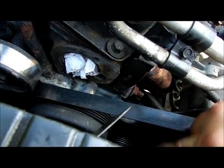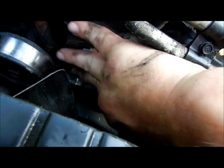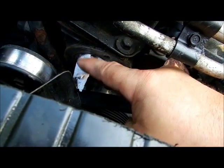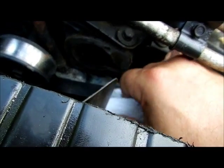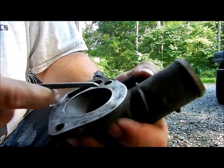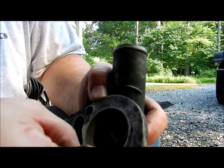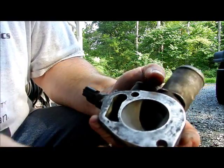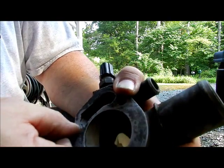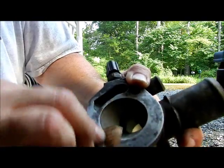You want to keep that belt nice and clean — you don't want any fragments getting on that belt. We've got to get down low, kind of below the belt line. That looks pretty darn good. Pull the paper out — try not to break the paper. That looks really clean. Use a chisel to get off as much as you can. All you're doing is putting a little pressure down, getting all the caked stuff off. Got the sealant and the gasket off. Get inside with your nail in the cracks to make sure nothing's in there. Use a piece of very fine sandpaper, same thing I used on the engine block, and sand. When you see something that's not quite coming off, use your thumb to scrape it off — it'll help you get down to the metal. You want this thing to look really, really good.